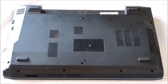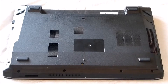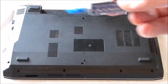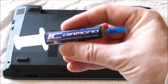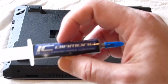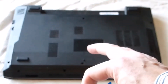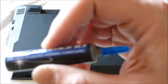You're also going to need a jeweler's Phillips screwdriver — nothing special. I've had this one for years and it's worked great. Then your thermal paste — my choice is typically IC Diamond. It's not the easiest to work with because it comes out rather thick, but before you even start disassembling your laptop, it can help to put it in a bag and place it in hot water while you disassemble, so it loosens up and becomes less viscous and easier to manage.